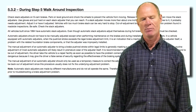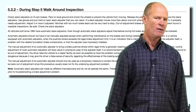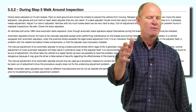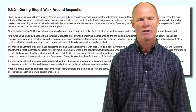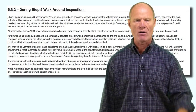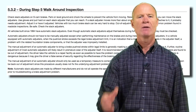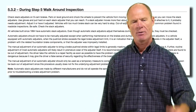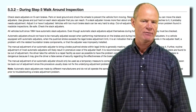You can adjust automatic slack adjusters manually, but it's not recommended unless you're in the middle of nowhere — as soon as you make a brake application, they go out of adjustment again. For your road test in California, use the pry bar method on every push rod on the vehicle. A semi-truck will have five axles and ten brake chambers; a bus has three axles and six brake chambers — check all of them. For low-clearance vehicles where you can't get underneath, you'll likely need to give a verbal explanation of how you would check pushrod travel.